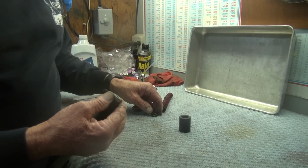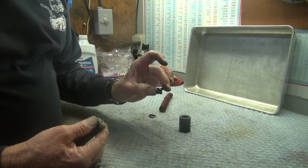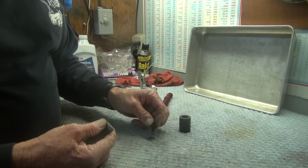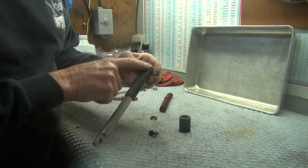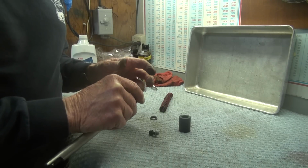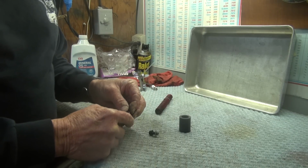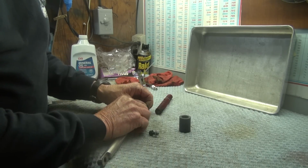And originally, the idea that I had when I put it together was I put this bolt and washer, if you can see that, inside of the spring, put the bolt in, and then I slipped the washer between the top coils, and then ran the bolt through that, and that held the spring attached solidly to this stainless steel rod. It's not necessary. I can see that today, but at the time I made this 12 years ago, I thought I wanted to have that on there and have it bolted together. As a result, probably the bolt pinched it, put some pressure on it, and caused the coil to break. But the seat still works perfectly. Until I pulled this out, I didn't know that I even had a broken spring on it.